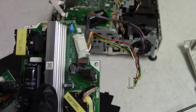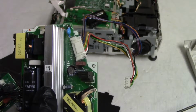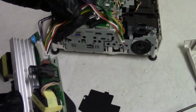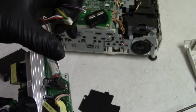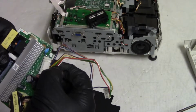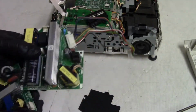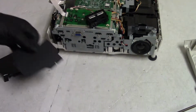That's actually pretty convenient. So, transmit, SCI common, or receive, SCI common, transmit ground, positive 17, positive 17, PSTH, power supply thermistor maybe, and then main on. So that's really what turns it on. So on, let's see, 1, 2, 3, so green and yellow should have 17 volts. If green and yellow have 17 volts, that's a good sign. We should also see some comm stuff on there. So before we go and start switching things out, let's measure what we have in here and see if we have to.